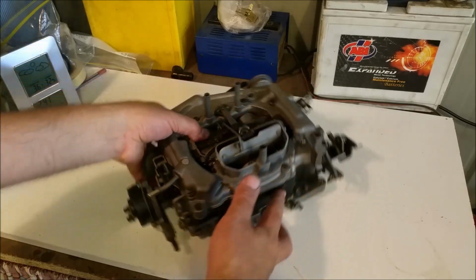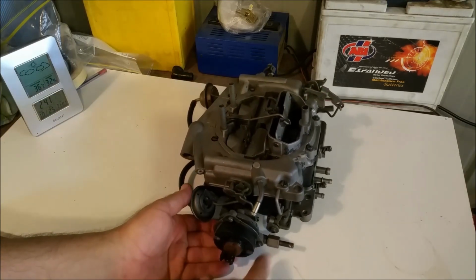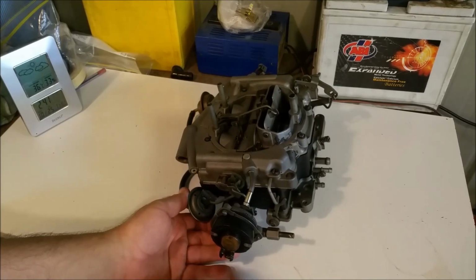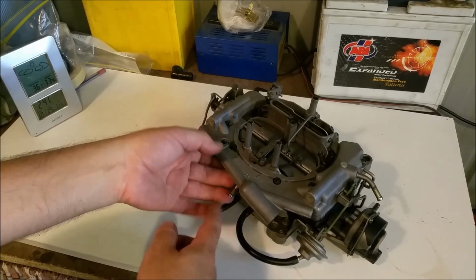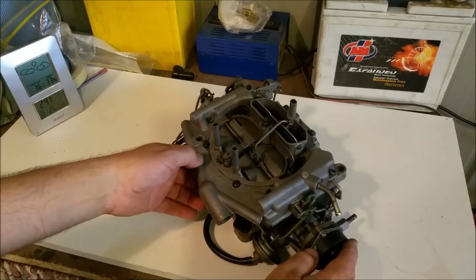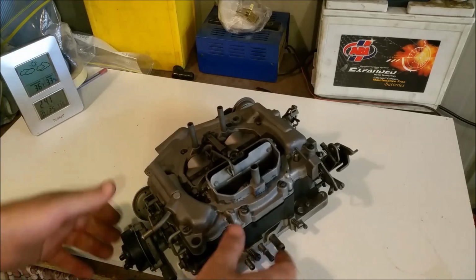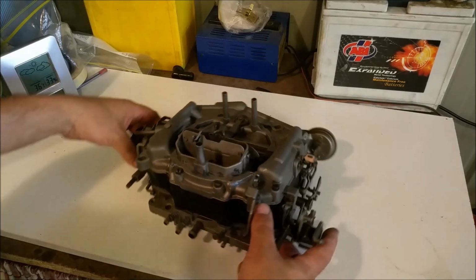Now they've got an electric and manifold preheated choke. So you've got your electric terminal here off the back of the alternator. This one goes down to the exhaust manifold and of course draws air in here. So that goes down to the manifold, comes back, goes through here. And of course we have a nice big heated choke then. Lots of different ports for EGR, PCV, distributor, all this sort of business here.